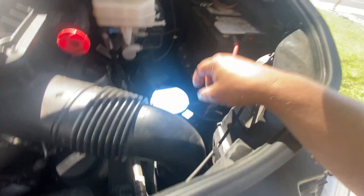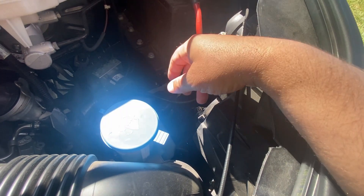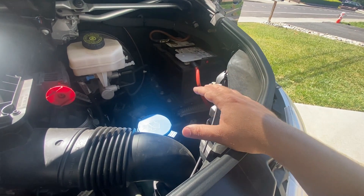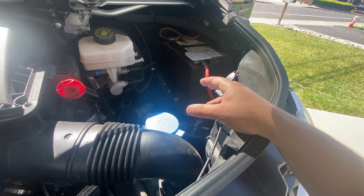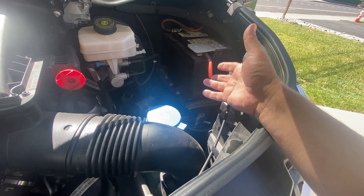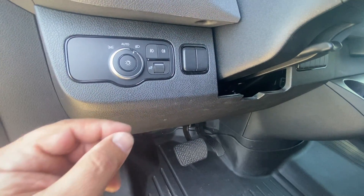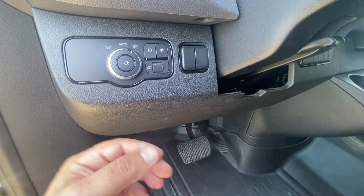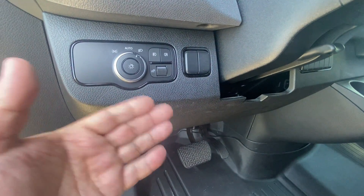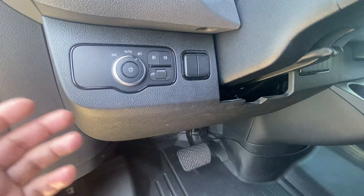Make sure these are going to be stock. If you have extra wires running to your computer that aren't needed — maybe you bought the vehicle second hand — get rid of that, as technicians get worried when they see it. One thing about catalytic converters: if your vehicle did not originally come equipped with one, you don't need to go and install one. Now let's jump to the California Air Resource Board website and take a look at what's currently exempt.